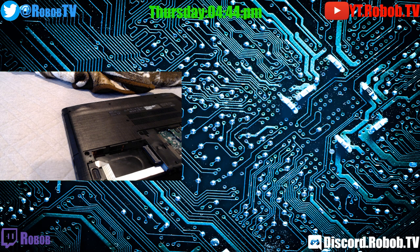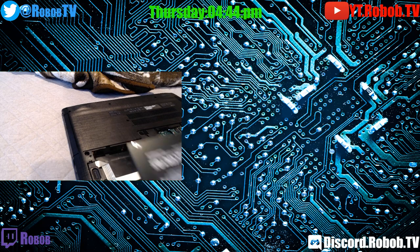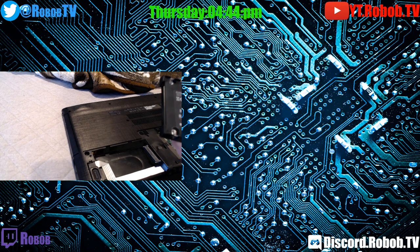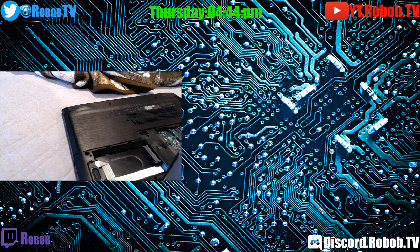This particular model — yours might not be the same — you got a little dinky plastic thing. So we're going to take that and put it over the SSD and make sure that it's not upside down, which it's not. I'm going to put the screws back in and they don't need to be really tight. This thing's mostly here for show — if it wasn't required to fit into this spot I probably wouldn't put it on. But in this case it's required to make it fit into the cavity for the drive, so we're going to put it back on.